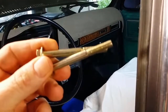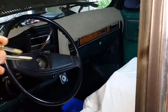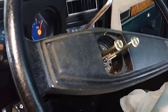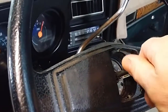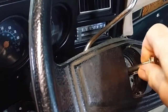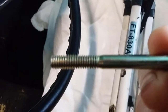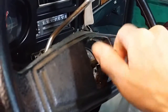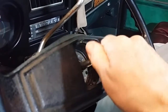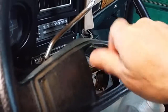When you get your steering wheel puller, make sure it comes with imperial bolts, not just metric, because this won't be metric, so just bear that in mind. Okay, after a fair bit of looking into this, it turns out that this is metric, metric 8, so 8mm metric threads or bolts. Yeah, so that's the correct thread, and you can see there that's a coarse thread, so UNC thread. This truck was made in California in 1977, but that's definitely, as you can see there, that's going all the way in. That's the correct thread. So apparently that's metric.